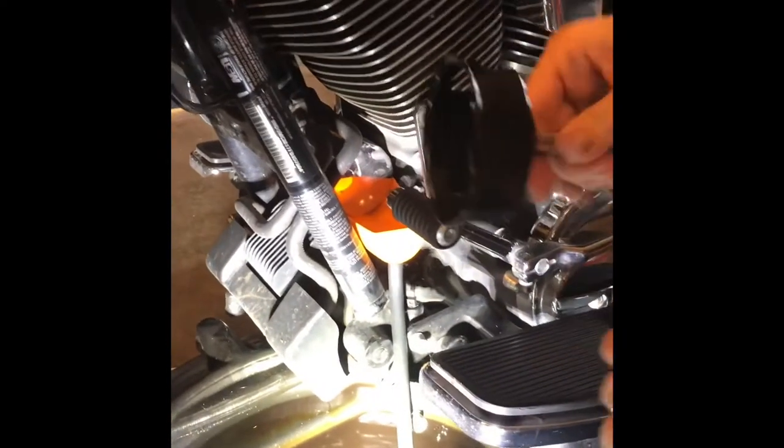That's it. All right, so next, this might be the hardest part. We'll see. We put our handy dandy little funnel catcher or oil catcher. We're gonna take the wrench here, the little filter wrench. We're gonna try to get this on here and loosen the filter. I also moved the oil pan so it catches. Now, if you don't have this, it sucks.